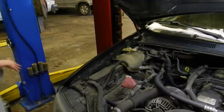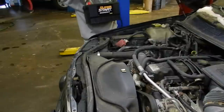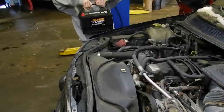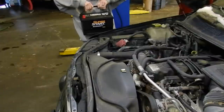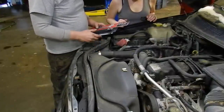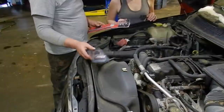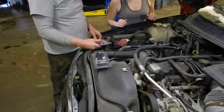Looks like we should clean the tray a little bit. One of the safety features is that we need a battery hold down, and I see that the factory one is missing. So we've got to create a battery hold down first. The factory battery hold down is missing, so I picked up a universal one from the parts store to secure the battery, because I know that's one of the tech inspection things they look at — to make sure the battery is secured in place.